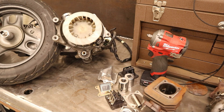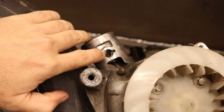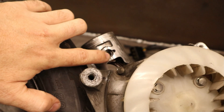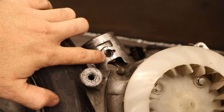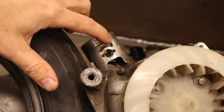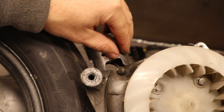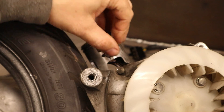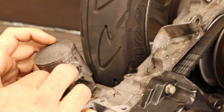Let's take a look at the piston here. There's our culprit. There's a small piece of the circlip from the opposite side that has wedged itself into the piston. As you can see it's got G clips, and from what I've always done and been taught, this is installed incorrectly. You can see it's at 9 o'clock here. The clip should be at 12 or 6 — top or bottom basically. You can see it spatted out pretty good on this side too.